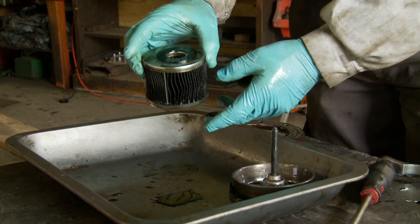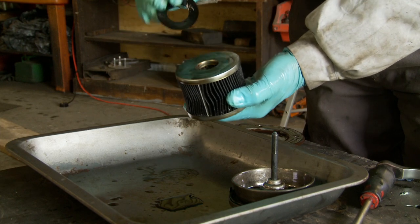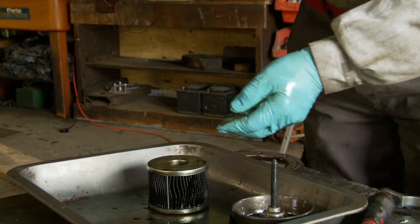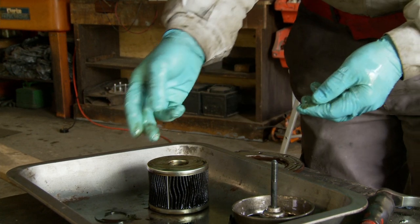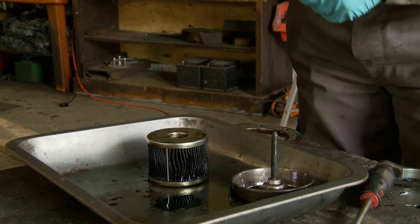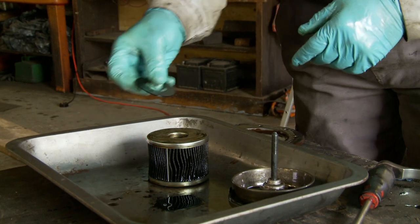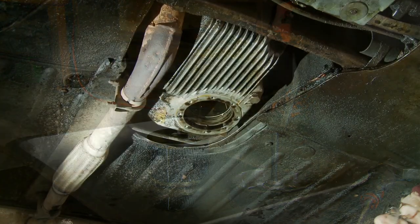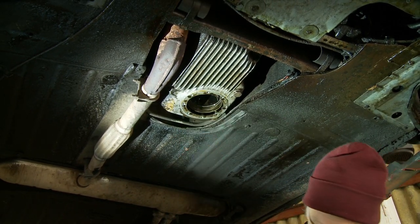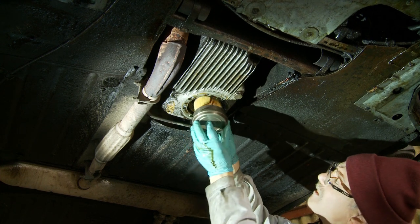Here we have a filter I've just taken out of the car. Sometimes the rubber sealing ring, which is fitted on both sides of the filter, can become displaced — it's only lightly glued onto the metal. The trouble is it can stick up in the engine, and if you then fit another filter straight onto it underneath, the washer can get sucked into the oil intake and block the system. So make sure the rubber is out by having a quick look up into the chamber when fitting the new oil filter. It's easier to fit the filter to the assembly and then offer the whole thing up as a unit.